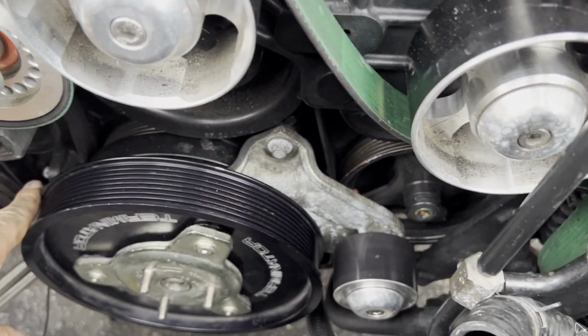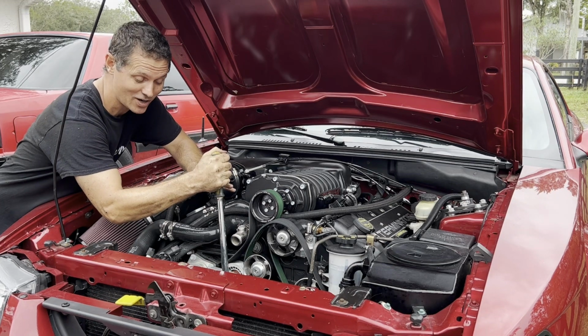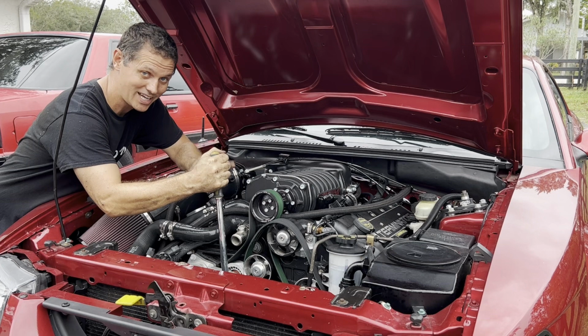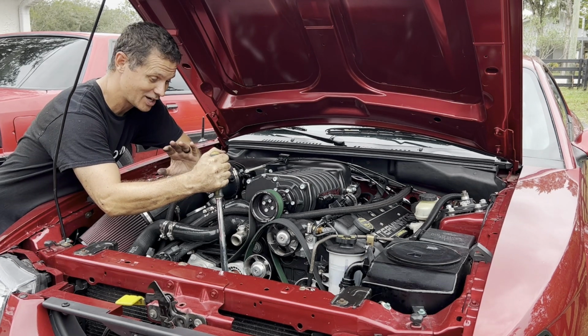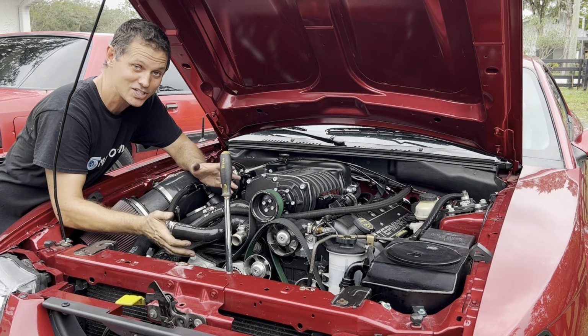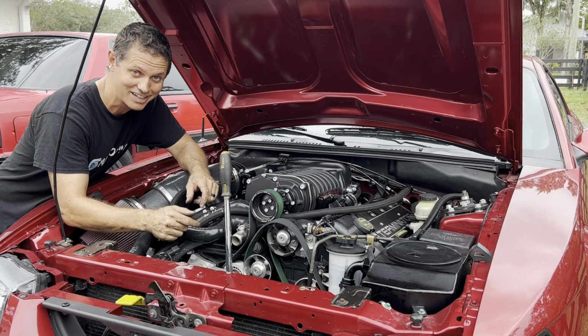All the hardware back in place and everything reattached. You do not have to monkey tighten this thing back on. You can just give this pulley a light snug, that's all it needs. The engine will tighten those left-hand threads when it's running and completely monkey tighten it for you, so next time you go to take it apart, it'll be just as much fun. It's like the gift that never stops giving. However, if this one fails on me again, it's out of here.